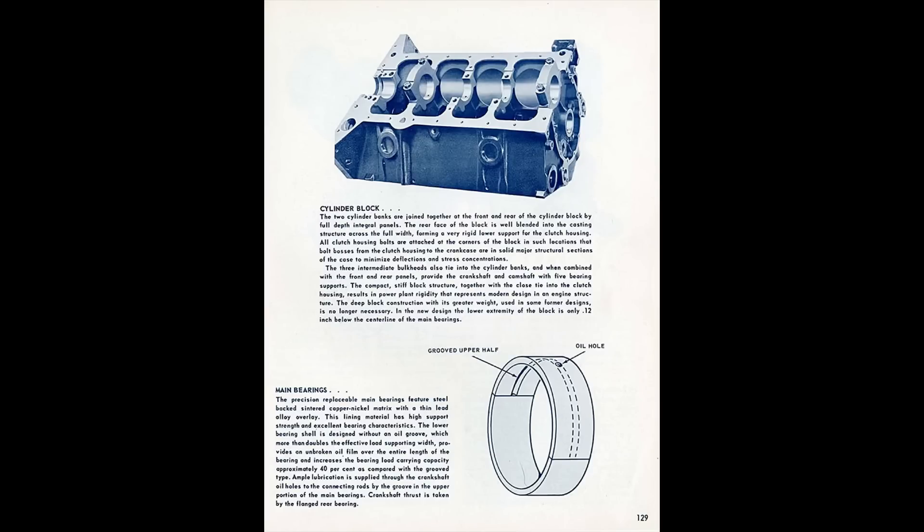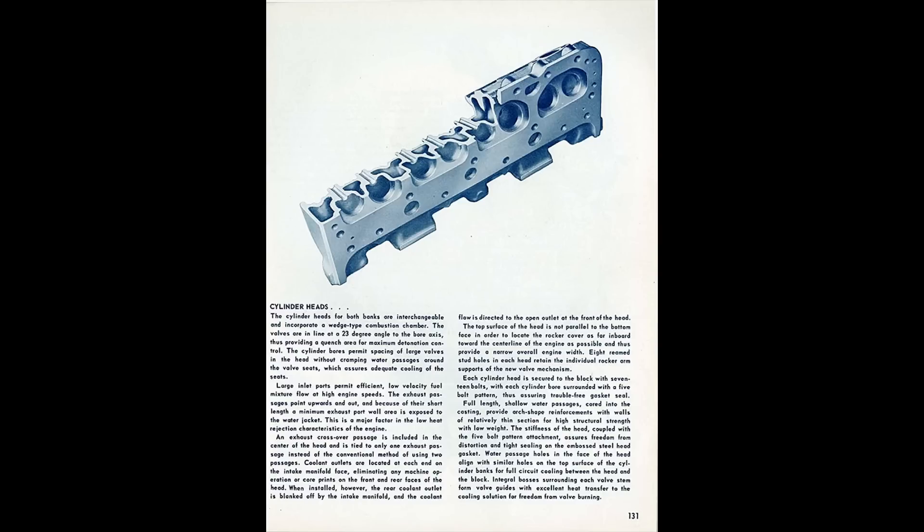The block size is pretty compact, all things considered — 21 and three-quarters inches long by nine inches tall from the oil pan to the cylinder head, which could fit in just about everything, weighing 531 pounds, which was 41 pounds lighter than Chevy's inline six. The block only required 12 casting cores; other companies needed 22, making the small-block Chevy cheaper to produce and allowing the cylinders to be cast with greater precision. It featured a forged steel crankshaft and connecting rods combined with a light valve train, giving the small-block Chevy a very healthy rev range.